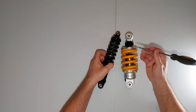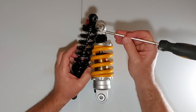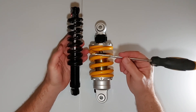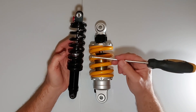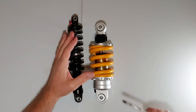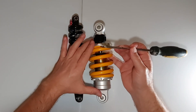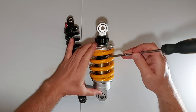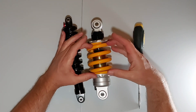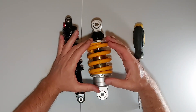I don't know if you can see inside here - inside this one it's got a tiny bump stop and quite a long sort of travel. That's okay if you're going to use the bike for downhill and you wanted lots of travelling suspension. But on the road, I only want a short bit of travelling suspension so the handling doesn't go all over the place. This new one has got quite a bigger bump stop and a very short amount of travel, so it takes a lot to compress it.